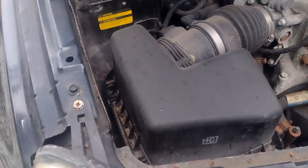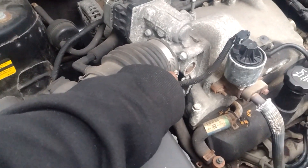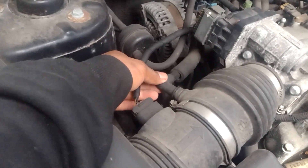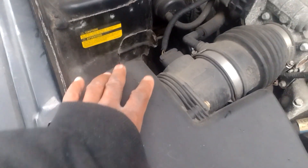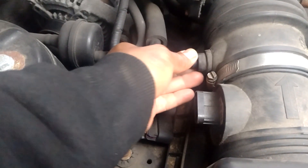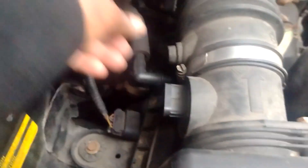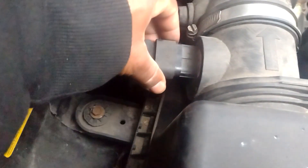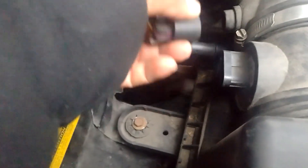I'm going to give myself some more space. I'm just going to take this air box and pull it off. Disconnect it here, pull these hoses off — mass airflow sensor — and pull this whole air box out. My PCV line pulled out too. I unplugged the MAF sensor and got it out.